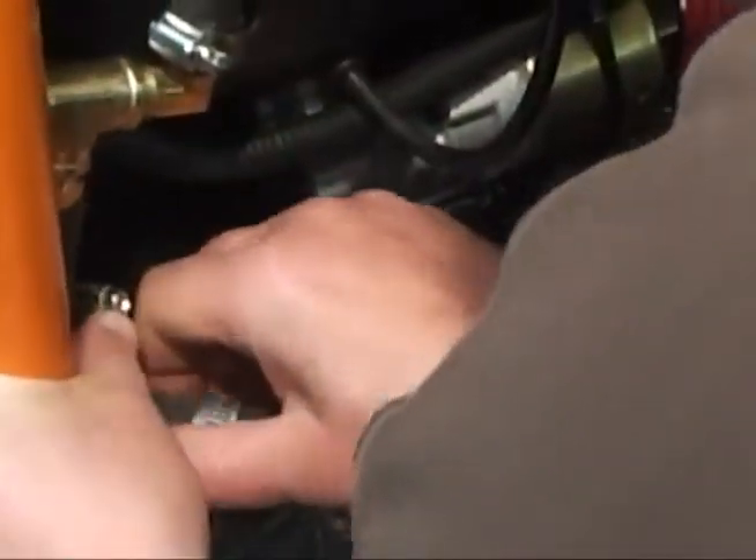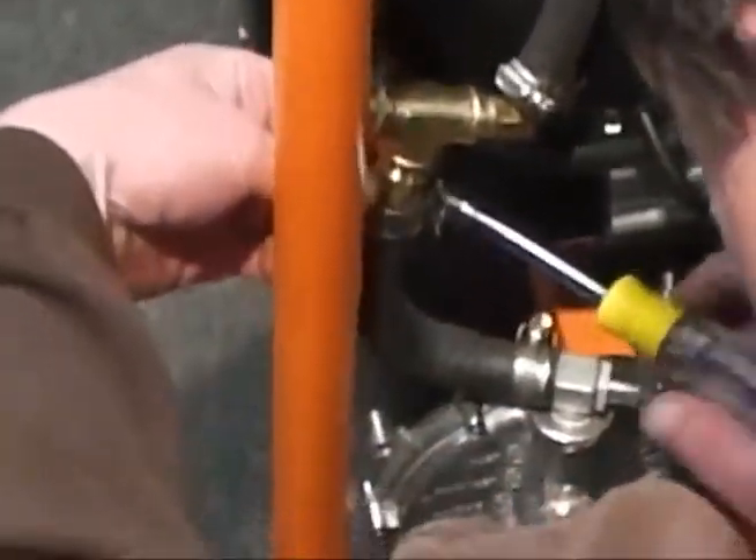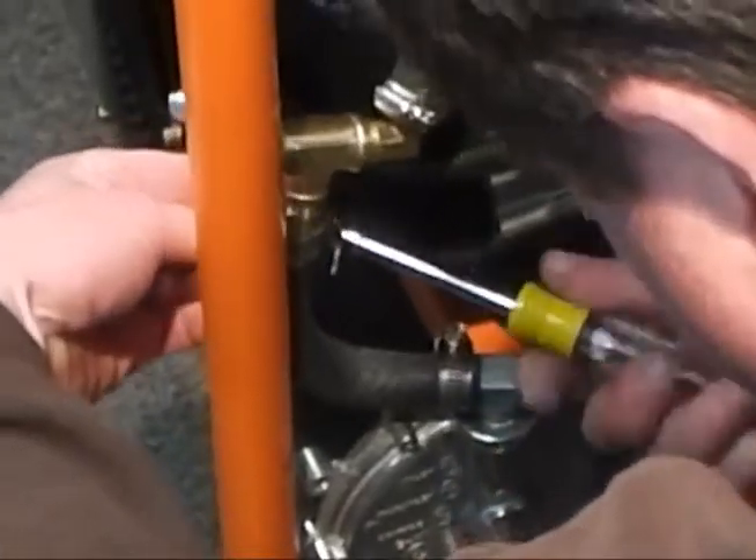Now that we got that, you're going to end up with two of these in the kit, so we're going to end up cutting off one of them. I'll just kind of slide it on here for now just to see my length. Just want to make sure we got no kinks in it. So we're going to take this and cut this here. Put our clamps over — get one more clamp, just like this on here. Just make sure you got no kinks in there because it'll restrict the flow. We'll get this tightened down, one more here, and then that'll finish this step.